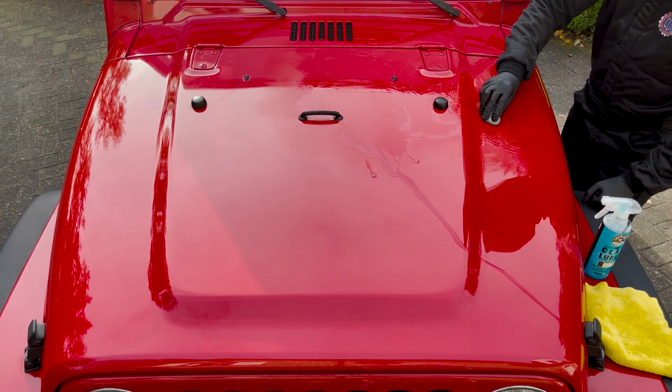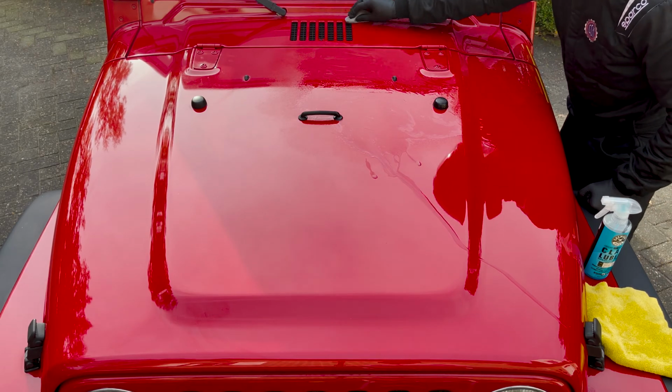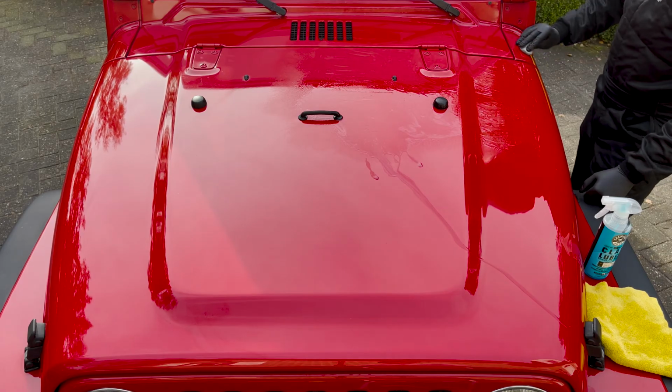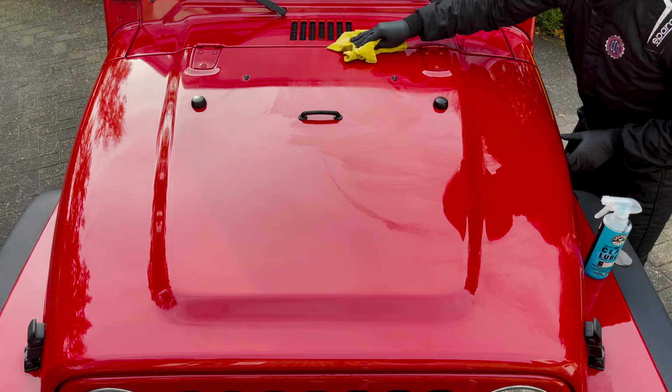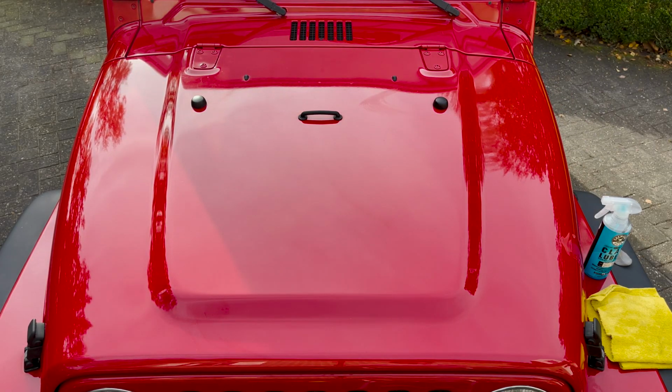Car glass also greatly benefits from a clay bar treatment because it will smoothen the glass surface by removing caked dirt and mineralization, making rain roll off much faster. Chrome, aluminum, and stainless steel can also be clay barred, as well as glass headlights. You want to stay away from plastics, however, unless they are coated.